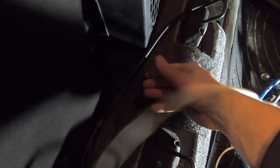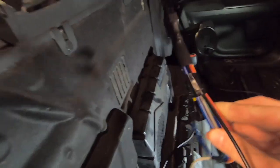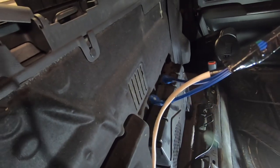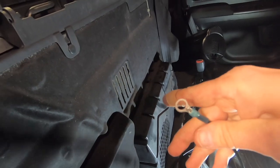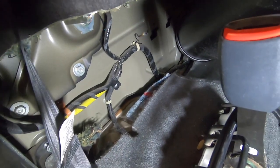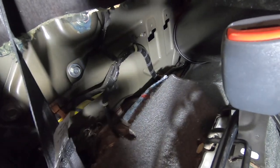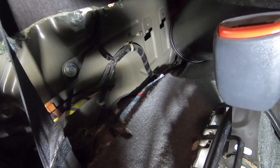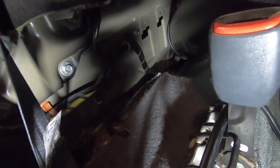I have a two-conductor cable and was able to splice everything into here. I'll plug that in. I've got a ground wire and there's a nice body ground bolt — a 10-millimeter bolt right up in the top right — I'll take that out, hook the ground there, plug in the subwoofer, and then I'm ready to at least test it before putting everything back together. Once the seat goes back in, there's no adjusting the subwoofer, so you want to set it up loud and then turn it down from the head unit.